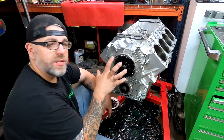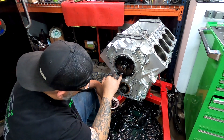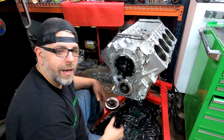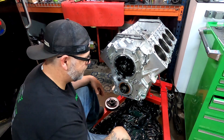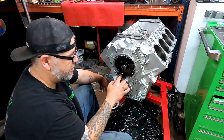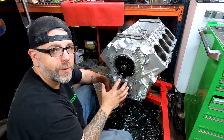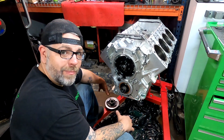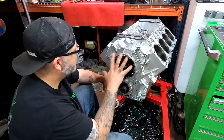I got the balancer off and pulled the plate off, and we are on top dead center right here. We can see we have some marks there — we're going to wipe it off because it looks like it was just some paint or something. We're going to go ahead and put a nice scribe in there — here and here — basically put our own dots in. The reason we're going to do that: when we know this is at top dead center, we can line up that dot here and this dot here, and now we should go back in exactly where we were. We might have a little bit of adjustment, but we're not making any cam or crank adjustments, so it should go right back in and be completely fine. To save ourselves the time, we only have to maybe just put the degree wheel on and check it once. Let's put some marks on here and pull everything off.